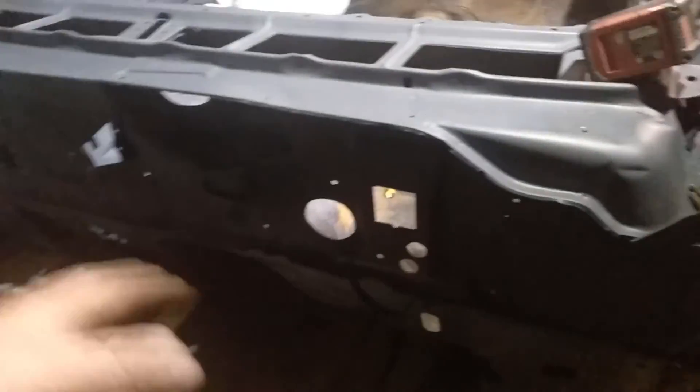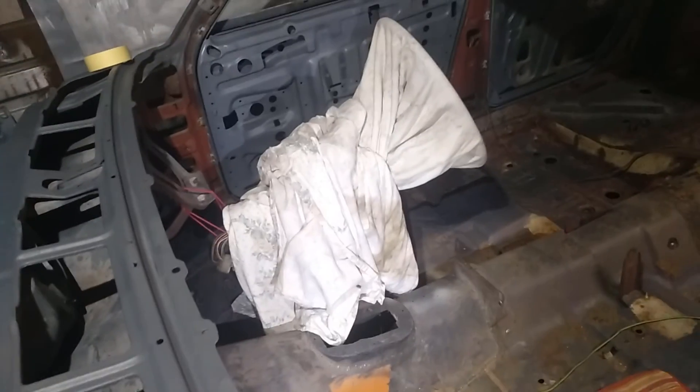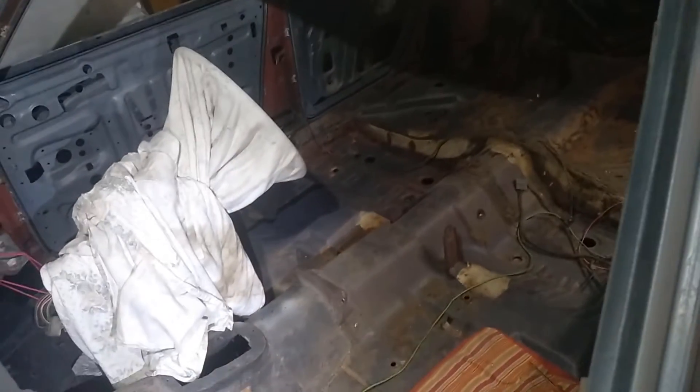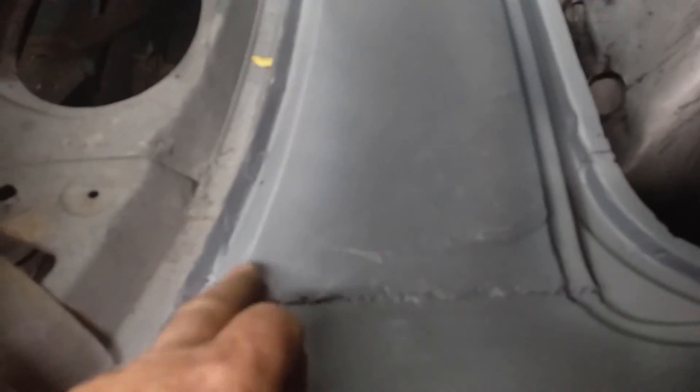Just in case I need to make changes, I can tap this off and close it up. I'm getting closer and closer with this body. Now that I've got some primer on, I'll get some seam sealer around these drip rails and get all of them sealed up nicely. I'll put seam sealer around this back boot - or trunk opening - and around the seams, and smear a bit over where I welded the back in so water can't get inside. Maybe just a bit in here as well to make sure that's all sealed up properly.